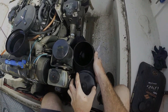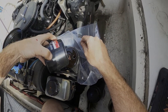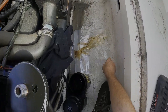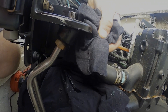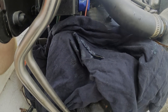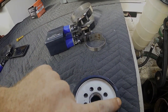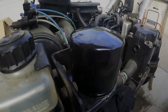I also have a bag ready. Once you've loosened the filter, bring it into the bag. I like to grab a rag and wipe all the oil into the bag. Once it's caught the majority of the oil, go underneath the edge and wipe any excess oil off. You can see how the strategically placed rag prevented an oil spill. Now grab some oil off the rag, apply it to the o-ring of the new filter, and spin the brand new filter on.